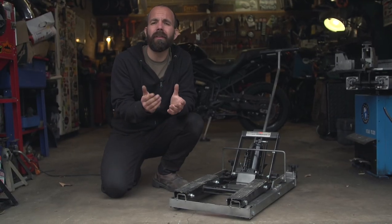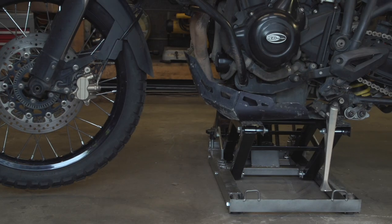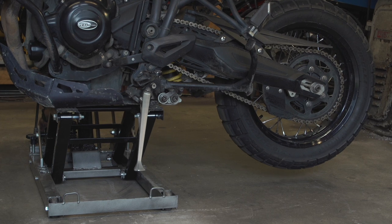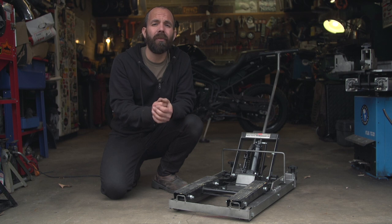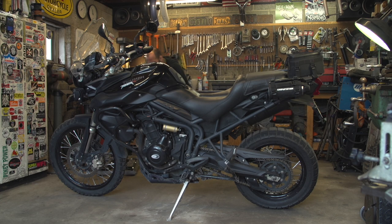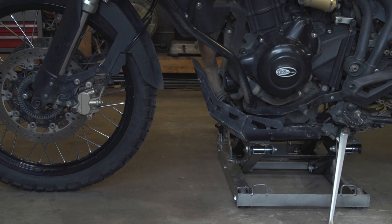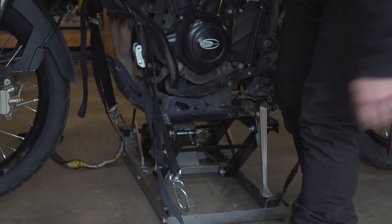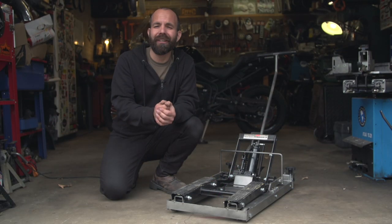Just be sure that the bottom of your motorcycle has a flat, sturdy place to lift it by — like a skid plate or frame rails underneath. On some bikes, especially adventure bikes, the exhaust pipe runs down below the engine itself, and that is not designed to bear the weight of the motorcycle, so be sure not to lift your bike by the exhaust system. Also, there's really no need to lift the bike all the way up in the air if you're just removing the wheels — it's a lot safer to keep it as low as possible, just raising the wheels a few inches off the ground.